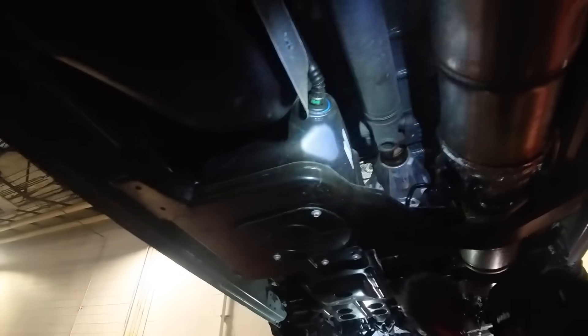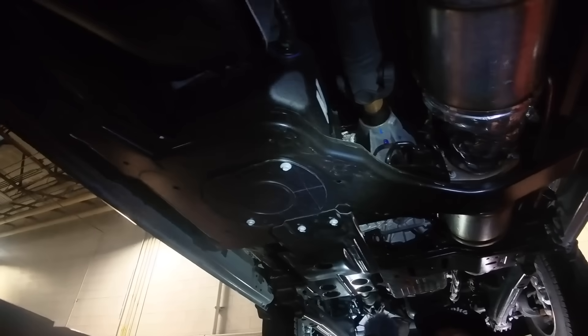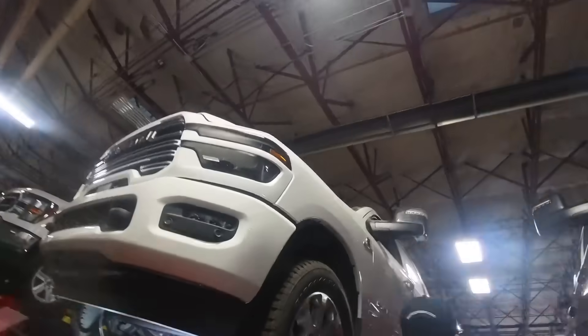On the 2024, they put a plastic cover over the DEF pump on the bottom — I'm not a fan of those, especially for off-road use. On the 2025, they did fix that with a full metal bottom. However, they made another critical mistake: the DEF line now runs underneath the cross-member. For anyone who likes to go out in the sagebrush or over obstacles, you're probably going to tear that line apart.